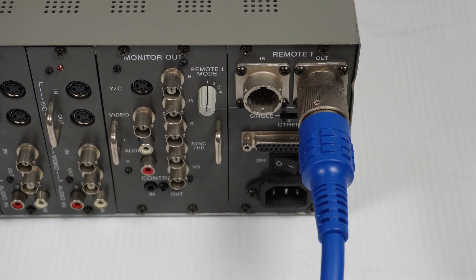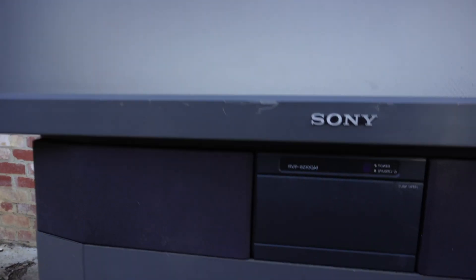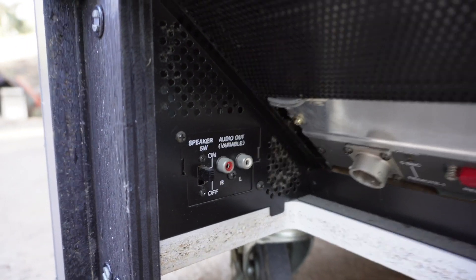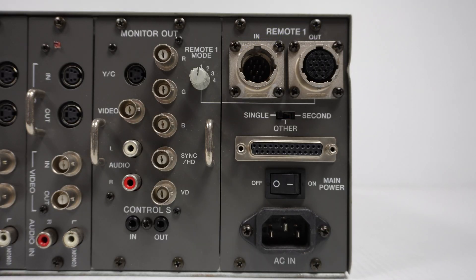So that would go like that. Then our other end would be connected into our old friend, the Sony RVP-6010QM. To do that, we travel down to the bottom front of the big unit, go to the left side, and you can see that big round socket - that's where we plug this cable in to transfer all picture and sound to the monitor. The purpose of the input side is that you can actually connect two of these units, two PC-1271s together. You run a cable out of the out on the other unit into the in on this one, and then run another cable out from here to your projector. That gives you a total of 16 devices all connected together to your projector.